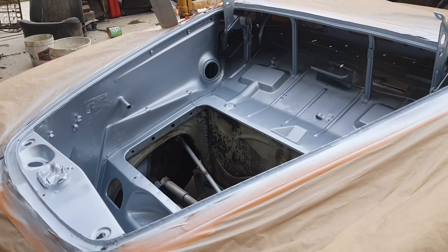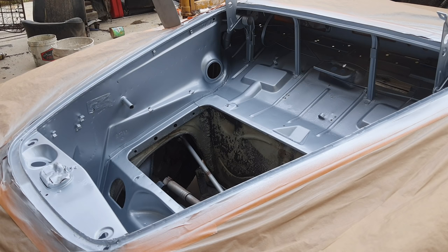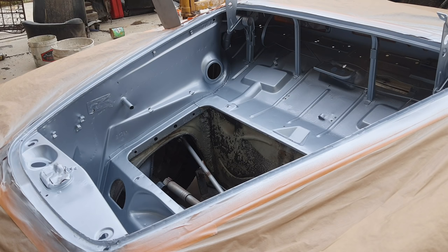Right, in this video I figured I'd put this in here too. If you're spraying metallics, a little bit of tricks and stuff like that to know. Number one, you got to put it on even. You got to be a little bit further away than when you're spraying clear coat. Don't get too close, because you want the paint just to lay on. You don't want to push its way on. You know what I mean?